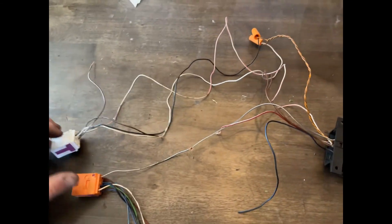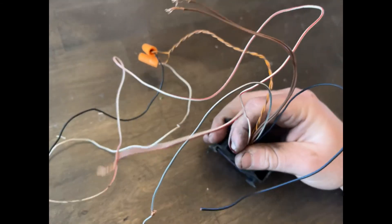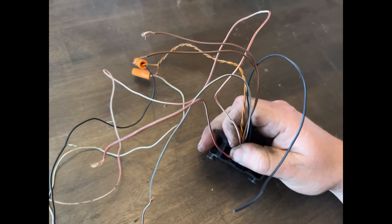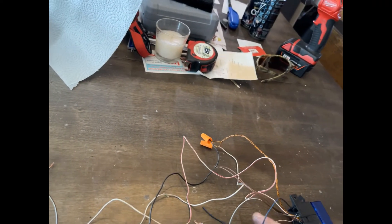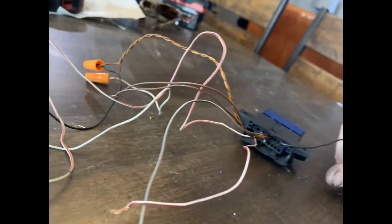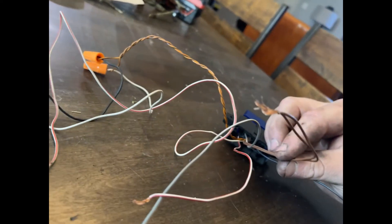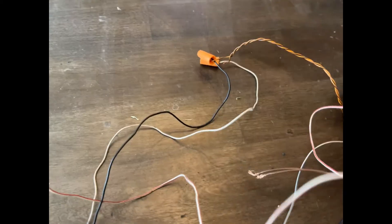Here's the OBD2 section of the ALH standalone wiring harness. Coming off the OBD2 port, there is a red-and-white wire going to 12-volt positive — if you put power to this, your OBD scanner will turn on no matter what. There's a black-and-blue wire that's the manufacturer wire, currently unused. The two brown wires both connect to chassis ground, and there's also another white-and-red wire in a different location.